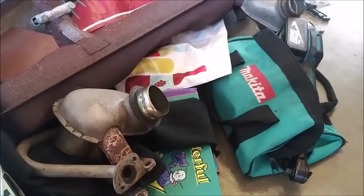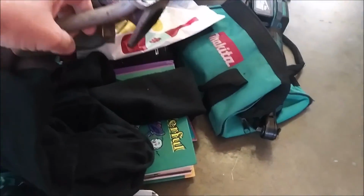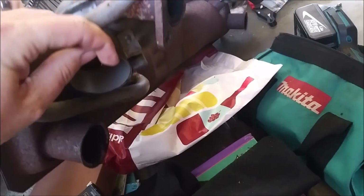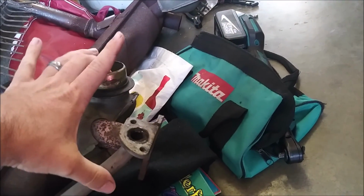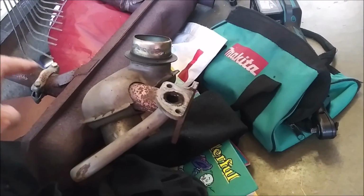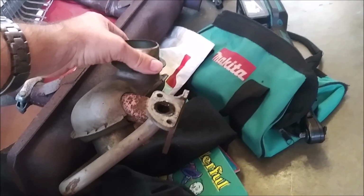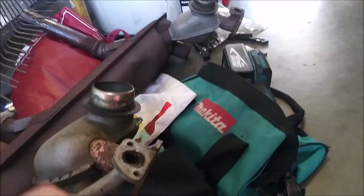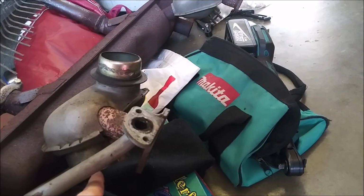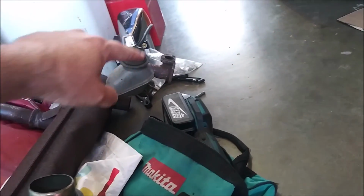I guess a better visual of what I'm talking about is these things, because these move, and this is where those clamps go. Well, these sleeves, we're going to call them. So once you get these sort of whereabouts they need to be, so you're going to poke through the tin properly, then you're going to bolt everything up, clamp it down. Then you're going to do one last adjustment so that these things are poking through exactly where they need to be for those hoses to clamp onto. And then, once we're there, you can go ahead and clamp it from below, and then you'll be golden. And then of course your heat risers will clamp there.